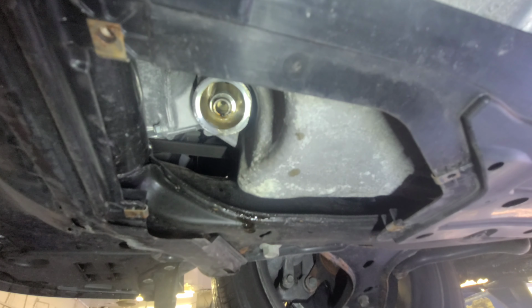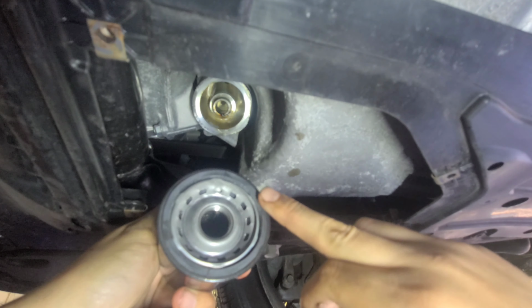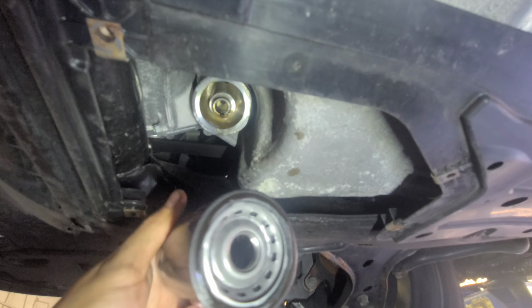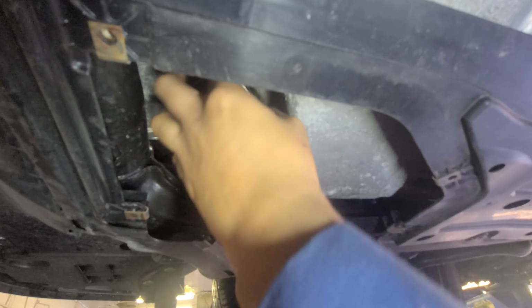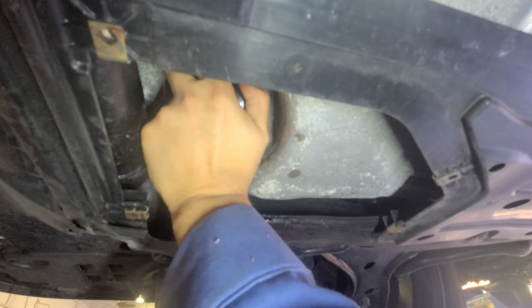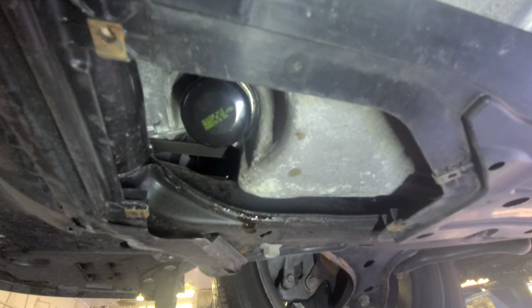673-56. You see, it's gonna dry this O-ring, so I'm gonna lube it with the same oil. Now how it looks. All right, now I'm putting it here. Installing the new oil filter. Tighten it by hand, don't use tools. You don't need tools to tighten this. I'm gonna take away my bucket. It's not a bucket though, but that's how I call it.